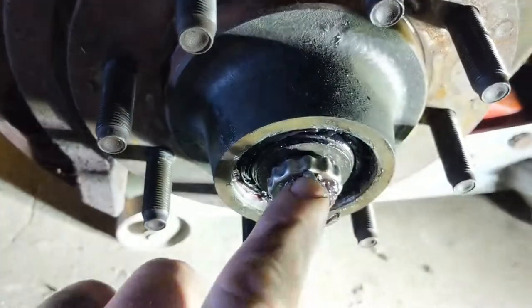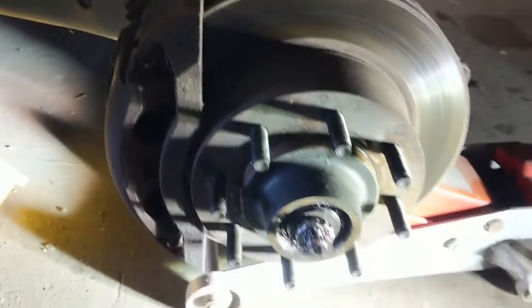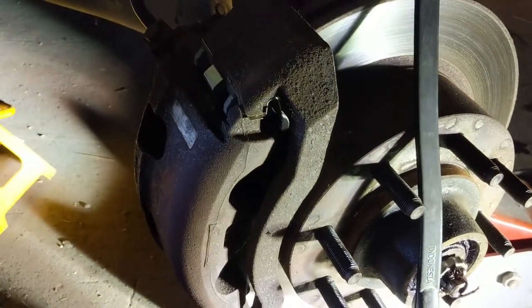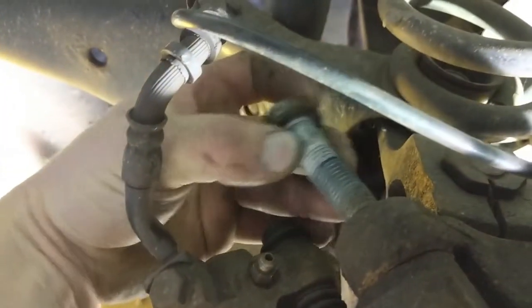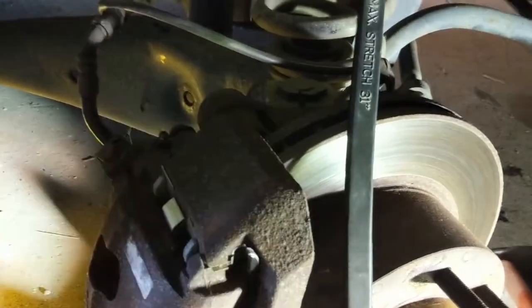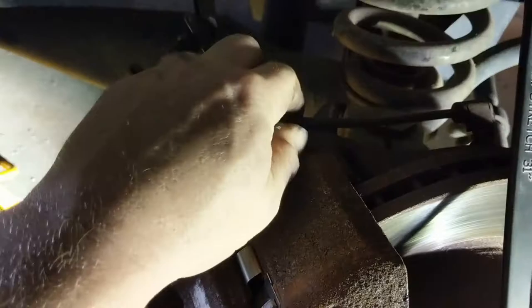I'm going to whip that off — I'm going to undo this cotter pin, this locking cap, take the nut off, pull this hub off, and then we'll have unrestricted access to the sensor. Sorry, I can't film this while I'm doing it — I'm here by myself and don't have anything to hold the camera. What I've gotten done is remove the top bolt and the one down below, which has knocked loose this whole assembly. Get yourself a bungee cord so that when you pull this off you can hang it — you don't want to hang this off the brake hose or the ABS wire. There's the sensor plug right there. You don't want the weight of this dangling while you're working.